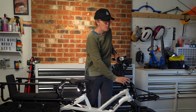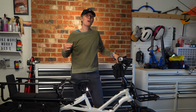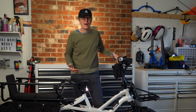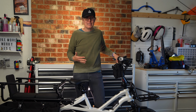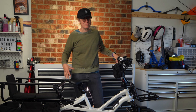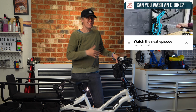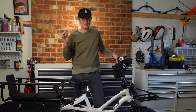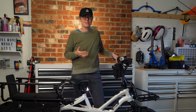It's crazy. But the other thing I use that vertical stand for is going to be service. These bikes start about 75 pounds without accessories, and it's really hard to get it in a normal bike stand. So I love that I can service it, even in my shop, in vertical, or when I'm out and about, if I get a flat or something sounds funny, I can stop, put it in vertical stand, attached to something so it's not wiggling around on me, and quickly adjust the bike, which is really cool.